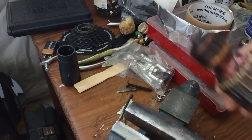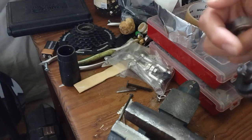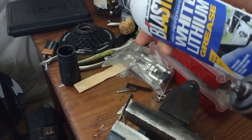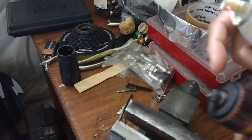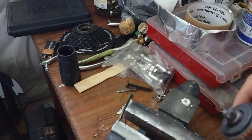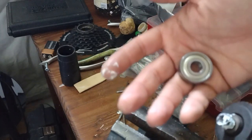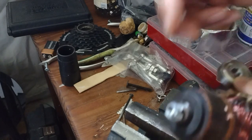I'm going to try to put a new bearing in for the one I removed. The first thing I want to do is lubricate this area here just so it's easier for the bearing to go in. I'm going to use white lithium grease - spray a little, but I don't want to make a big mess spraying it right on top. I just put it right here and grab some of this grease and try to apply it right over here. You can do the same thing on the bearing - put some lithium grease in here, but I think what's here is enough.